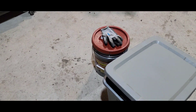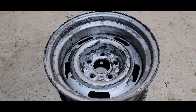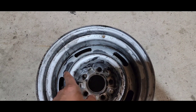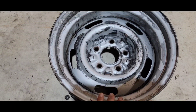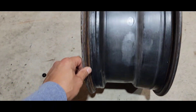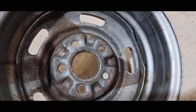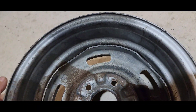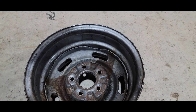What I'm working on is these wheels. Like I told you guys before, Evaporust — man, I love it. I soaked this rim in it overnight. It was rusty all the way around and I was trying to hit it with paint stripper to get this paint — or powder coating, I don't know what it is — but it barely touched it. So I'm going to hit it with my wire wheels. I went to Harbor Freight and bought a bunch of wire wheels. It took a lot of the rust off — surface rust that was on this rim. As you can see there's still a little bit in there, but you can see the lines where the Evaporust cleaned it up. So I'm going to come back with my wire wheels, hit it real good, get it cleaned up, and then sandblast some of the areas I couldn't get with the wire wheel.